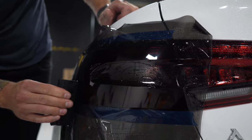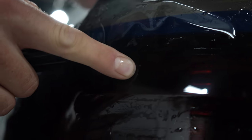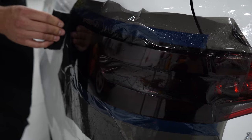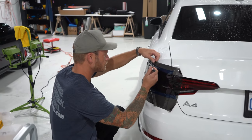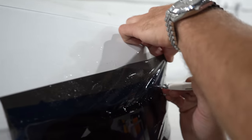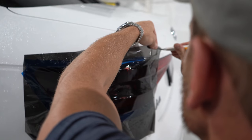That little dot is a casting point for the taillight itself — a lot of taillights have those. Now that I've done this, what I'm going to do is trim out the exterior. This is why I have the painter's tape here, and this is going to allow me to get some tack solution down underneath that edge. One day I will do a comparison video of the air release tint finish versus the non-air release finish, and we'll also get into more complicated lights.